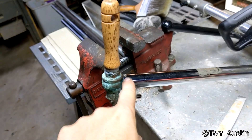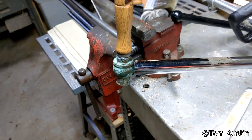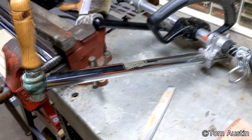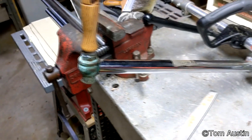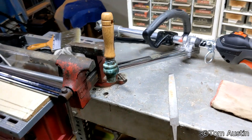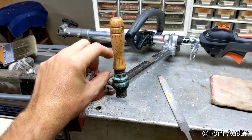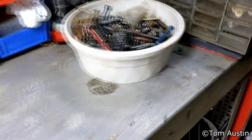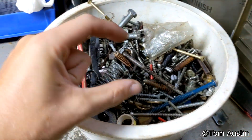This was almost the same diameter, so I just beat that into the end of it, drilled a hole, cleaned through it with a 1/8 inch bit, then I grabbed a random miscellaneous fine-thread screw in the correct diameter, ran it through there, and then as soon as it seated, the impact gun sheared the head of the screw off. So we're stuck with this — unless it really screws up, then I'm going to snip that end off and do something else.